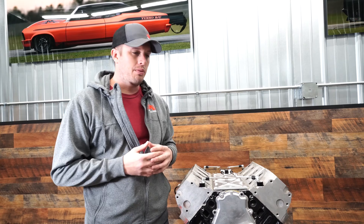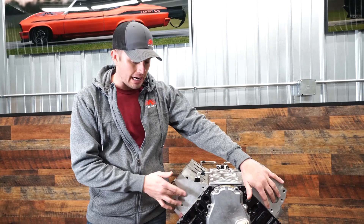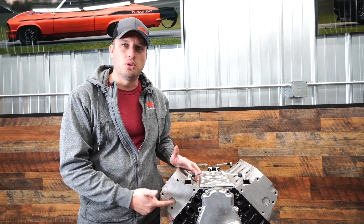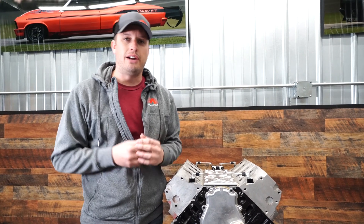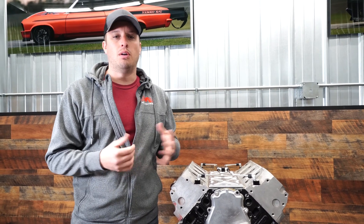We've been around several years and one of the things we notice every year is there's a certain amount of people who, with a nitrous or boosted application, will actually push these out. Behind them they're casting plugs from the factory, but behind them there's coolant, so when they get pushed out there's coolant everywhere. Of course that's really dangerous when you're drag racing. If you're on the dyno or just doing a burnout it's not nearly as bad, but anytime water or coolant gets on your tires at any speed you have a real potential for injury, wreck, ruining your whole project, and everything in between.